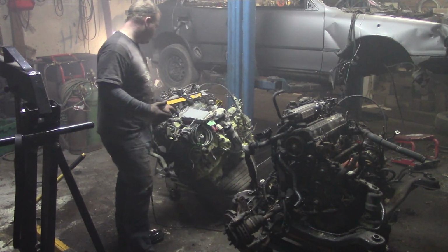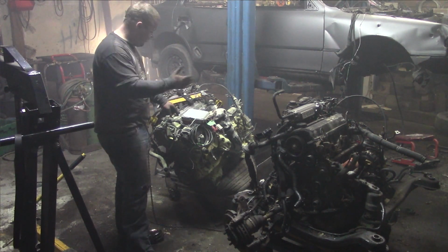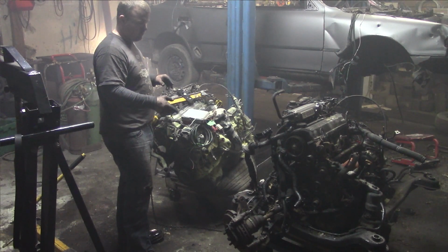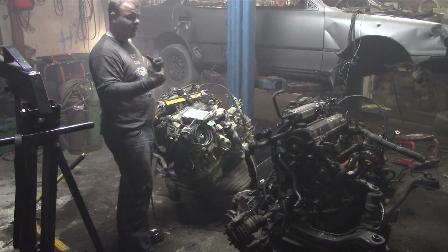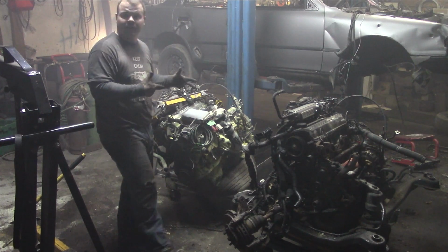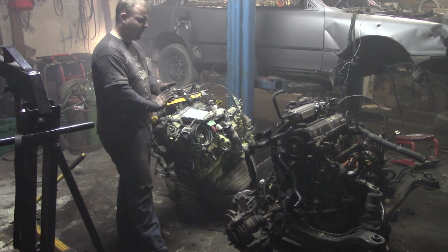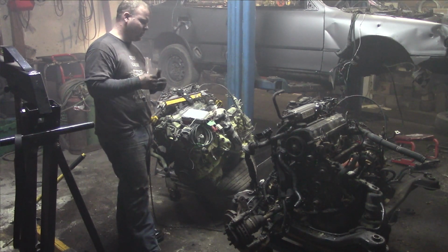Now these newer ones, I have one for parts. So three for parts, one for parts. I'm gonna go for three. So what we're gonna do is try to pop out the axles, undo the motor mounts, lift it up, and undo the back motor mount from the block so that we can use the passenger side inner axle. And I think that's it. Let's get her done.